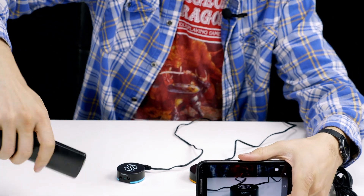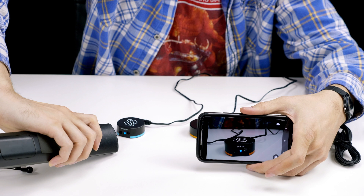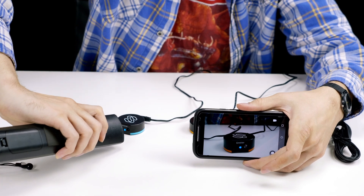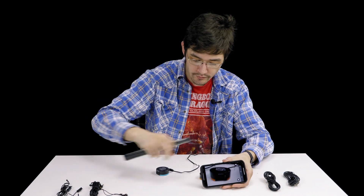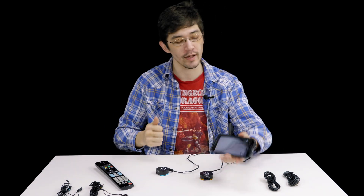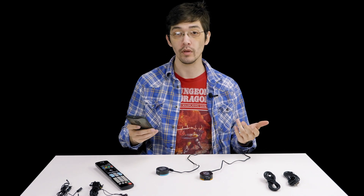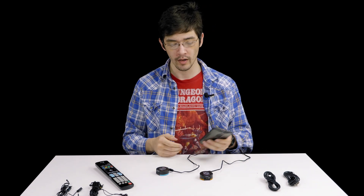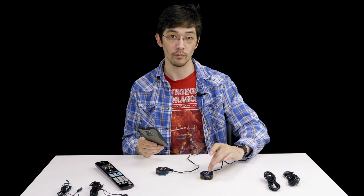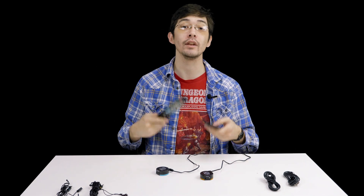So if we look at the Blast IR itself and trigger the receiver with the remote control, we'll see two things: first the indicator LED will light up, which we can see with our eyes, but through the camera we should also be able to see the infrared emitter lighting up with infrared. If the two halves of the kit are doing that — if it is broadcasting infrared signals but it's not controlling your device — it could be that compatibility problem. Note that some camera phones have an infrared filter that will prevent you from running this test, so before using your phone to test the Blast IR, do the same test with your actual remote control first, just to make sure your camera doesn't have an infrared filter.